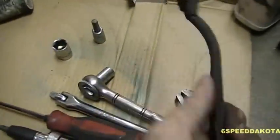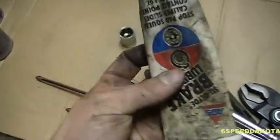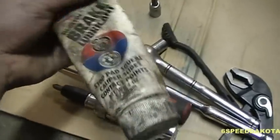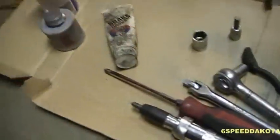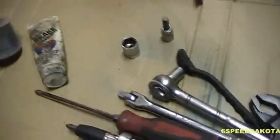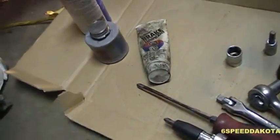You're going to need a wire brush to clean stuff up, a little bit of solvent or mineral spirits, and disc brake quiet. Now you don't need that specifically — you can use silicone brake lubricant to put on the back of the pads. I do a lot of brake jobs so I can warrant the use of this, but just a little packet of brake lube will do if you're only doing one brake job. Anti-seize as well — you can get a little packet of that too. I work on a lot of cars so I use that kind of stuff all the time.